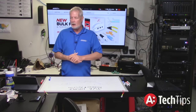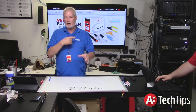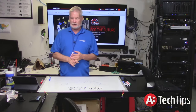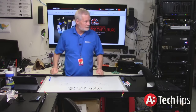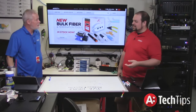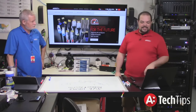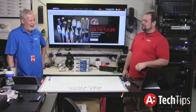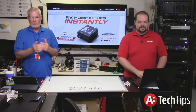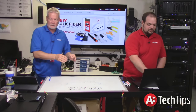That kind of sucks — you can't have your customer going back there plugging and unplugging wires every time. When you look into the system, typically the TV always works and the other display does not. Why this is happening is a disparity in EDID. EDID is the 'who are you, what are you' — your resolution, bit rate, color, audio type, and the HDCP handshake.